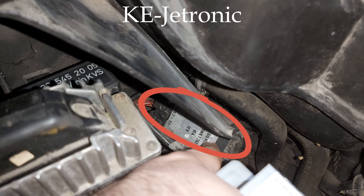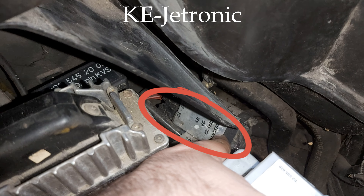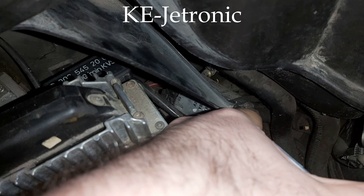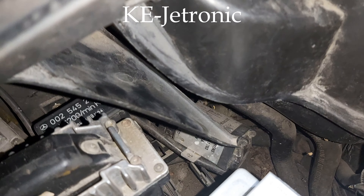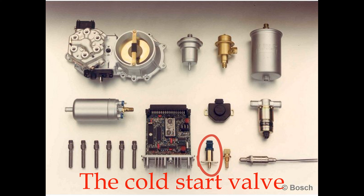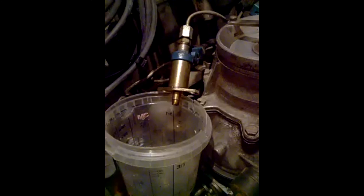There is also an OVP — an over-voltage protection relay — located parallel to the ECU. It has a gauze lid and a fuse, which is how you can recognize it. If the ABS light turns on, it is most likely that the OVP has failed and should be replaced. The cold start valve is another component of the system. Its task is to make cold starts easier — it has a chamber in which condensation is significantly reduced, allowing fuel to flow atomized into the cylinders for an easier cold start.